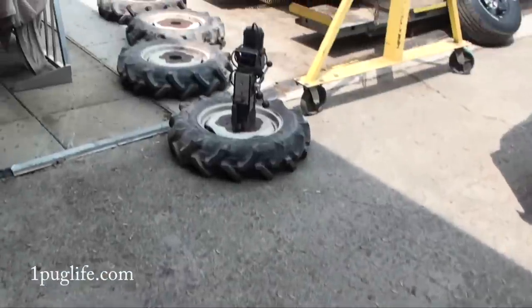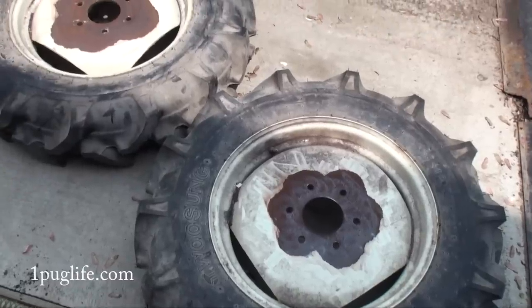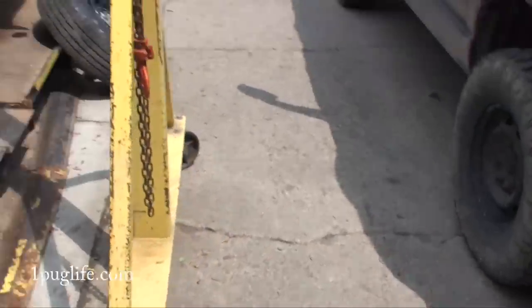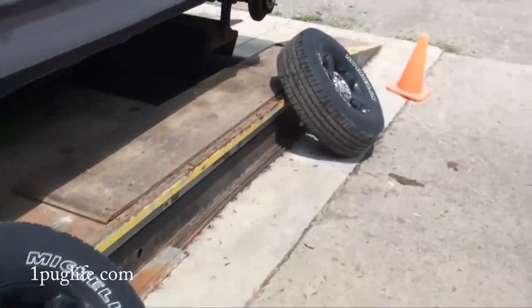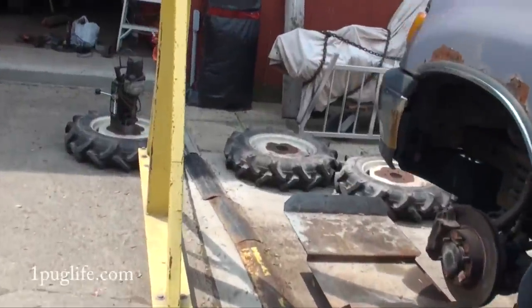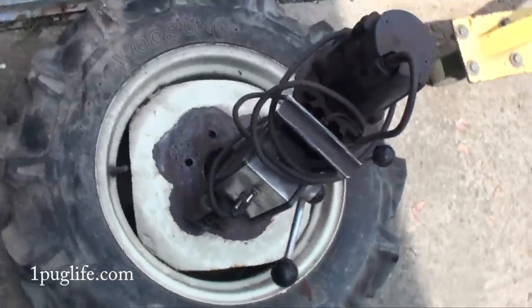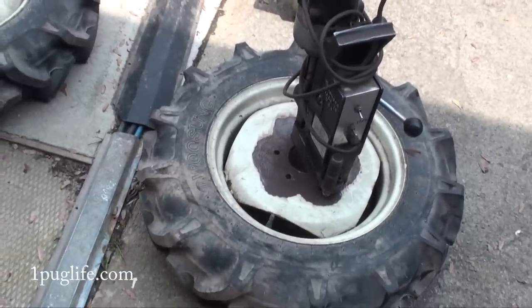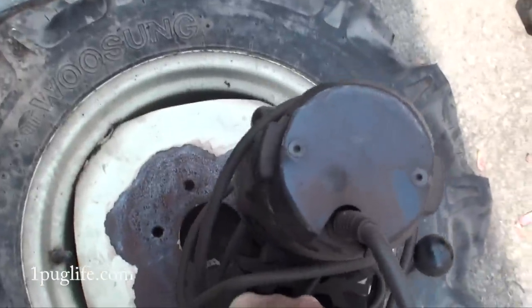See if I can't find them. Maybe we can just rework them to fit the application on Big Bird. The one good thing about cutting wheel spacers is we won't have to open up the middles — we can just leave those — so we'll just have to drill the holes in accordance. Hopefully find some spacers. I can put the backs on I think, but we'll have to open up the middle. So the plan's already changed, boys, but we can still drill the holes. Gonna try the mag drill, but I don't know if there's enough surface — it's got quite a bit of paint on it too. We'll see if it tears my arm off or we'll have to hand drill them I suppose.